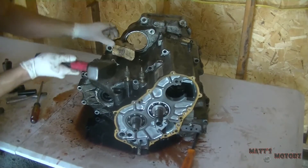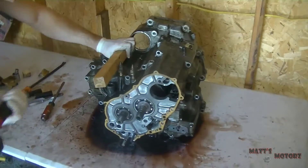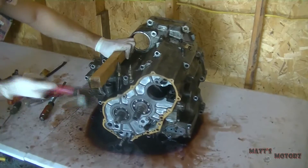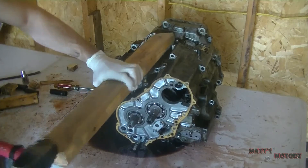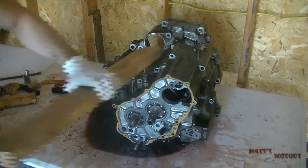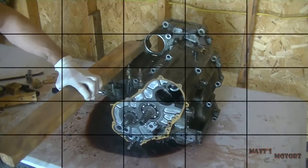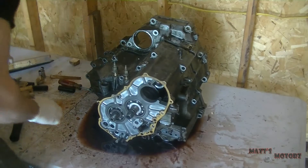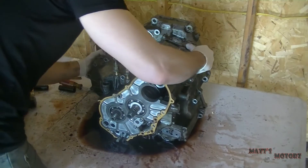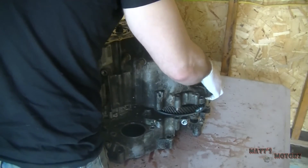Now this is a really hard part — you can see my pieces of wood get bigger and bigger. I use a piece of wood to smack the back of the case so it doesn't hurt the case, and just lay into this thing because it was really, really stuck. I was smacking this thing forever. I try not to do a lot of prying around the sides so it won't hurt the mating surfaces. It's starting to come apart now. Now I'm gonna flip it on its front and then pull the case off.